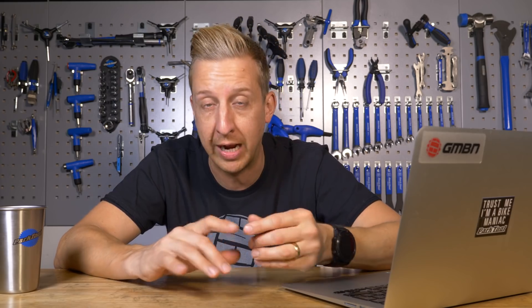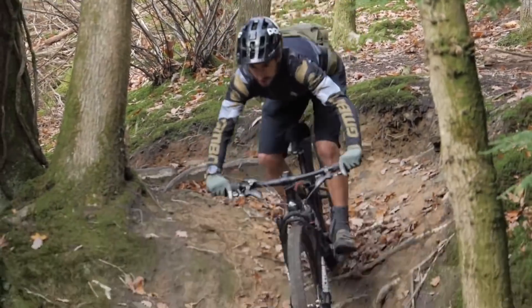Also take into account the tire pressure, which has a huge effect on whether your brakes are suitable for the bike and the type of riding you're doing. Next up is suspension — make sure you have your sag set up correctly. If you haven't got enough sag, the suspension is quite firm, it won't be reactive, and there's more chance of your front wheel slipping or skidding out when you reach for the brakes. Riding conditions matter too — if you're riding on gravel and grab a handful of brake, your wheel is going to slide out before it grips, so it's not going to slow you down. Having extremely powerful brakes on a surface like gravel might not be the best thing.